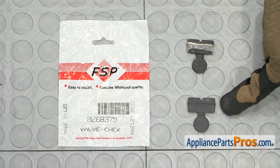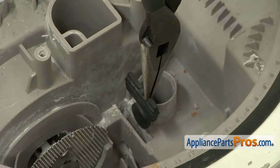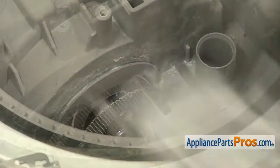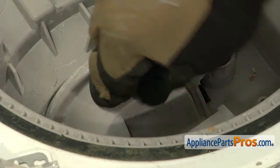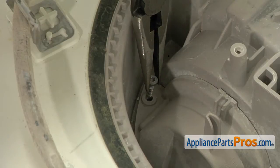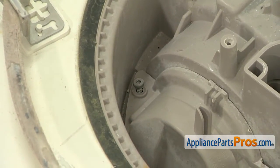Here's the old check valve next to the new one. If you already have one of these, great; if not, you can get it at AppliancePartsPros.com. To put the new check valve in, we're going to grab it with the needle nose pliers again and all we have to do is push it down into its spot. Then we can put the cover back over it because the cover holds it down. All you have to do is lower the cover down onto its spot, make sure it locks in place, and then we can put the screw in. We can use needle nose pliers to get the screw down into the hole — it's kind of hard to get down there on the end of a screwdriver — and then use our Torx 10 driver to tighten it up.